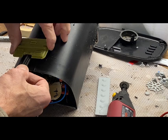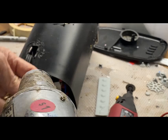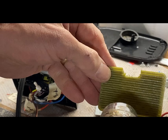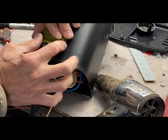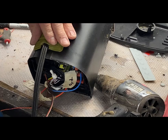I like this little greeble. I need to bend it, so I'm going to heat it up a little bit. When you're heating up PLA, you heat it for a while, and then it suddenly gets to a point where it's ready to bend. And it gets really soft really quickly at that point. And now I'm just going to crazy glue it in place.